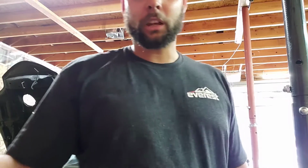At best cutting a 1.7 60 foot. That was foot braking, so my expectations obviously weren't very high, but I was only able to build about 2 pounds of boost with the manual boost controller, trying to get up on the chip, which just wasn't happening for me. But anyways, I decided to make some changes. I can walk you through those real quick and talk about a couple things as well.